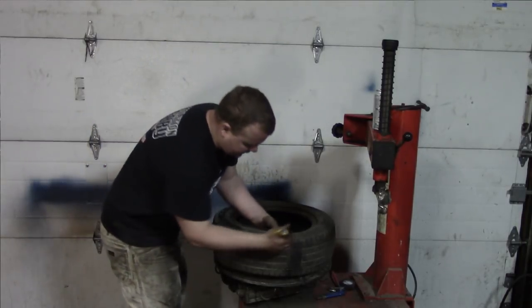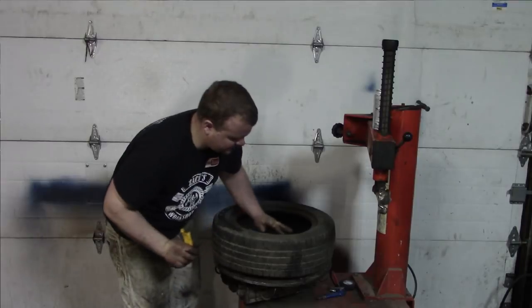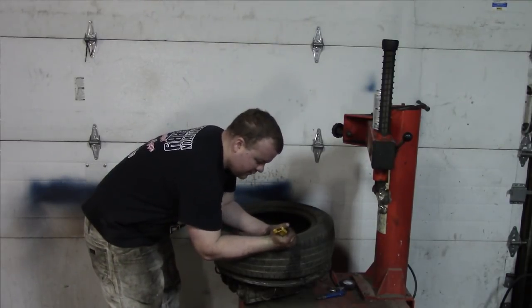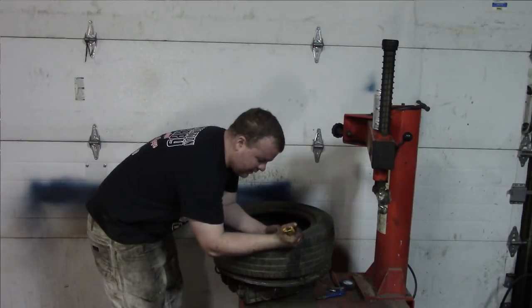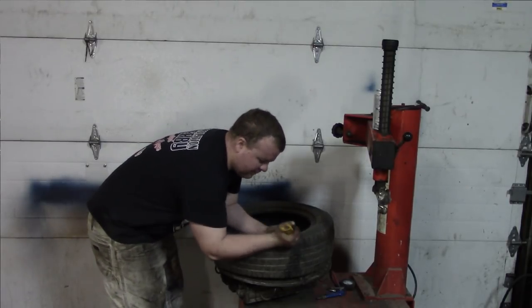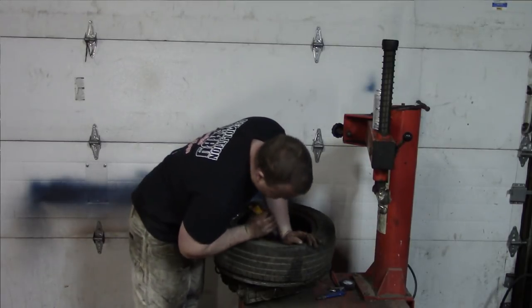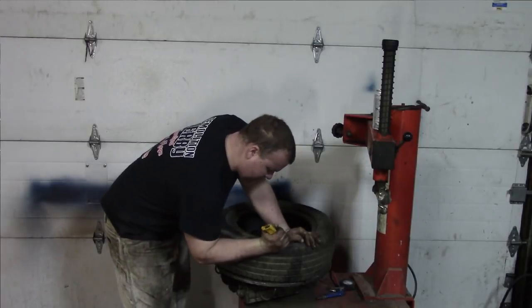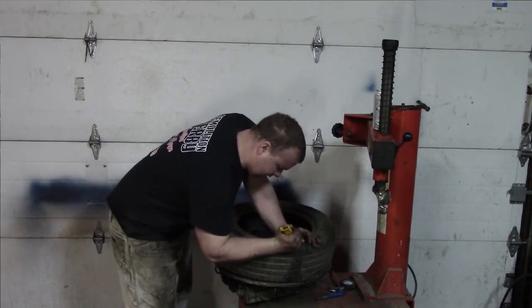What we're going to do is dig the knife in right at the top of the side wall where the treads begin. Just dig it in and bring it back. Make sure your hands are clear from the bottom side. You want to avoid all the steel bands. Just go a little bit lower. You want to basically cut the side wall out of the tire.